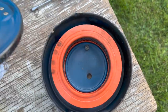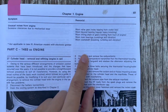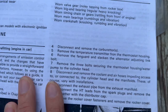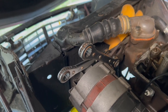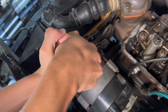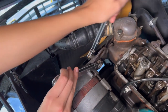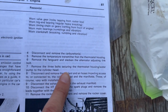We just popped this off and here is what my air filter is looking like right now. Now that step four is done, we're moving on to step five: remove the temperature transmitter from the thermostat housing, which I actually think was the little wire that's already loose — so we may already be done with that step. Since number five is done for us, we're moving on to number six: removing the fan guard and slacken the alternator adjusting link bolt. I've got these two little clips here and I'm just going to squeeze them together to slacken the alternator.